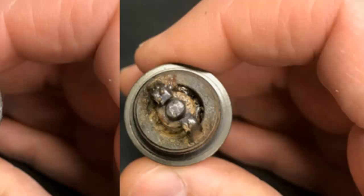You'll experience this as a pilot as a rough running engine when you do your magneto check. When you switch from both to one, whichever magneto is connected to one of these fouled plugs will run a little bit rough. Sometimes if it's just a little bit fouled, you can bring the RPM up, maybe lean it a little bit, get the inside of that combustion chamber hot, and it will melt off the carbon or lead deposit. When you recheck the magneto you'll be good to go — and that's acceptable. If you can clear it up like that, then you get to go flying. Don't push it though. It is possible to overheat these engines on the ground, especially when they're misfiring. Pre-ignition and detonation can happen when plugs are fouled like this. So don't sit there for ten minutes trying to free up the spark plug.